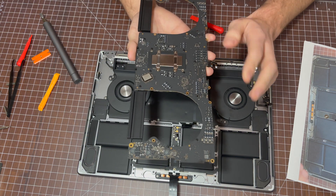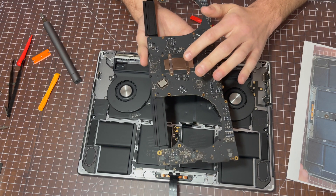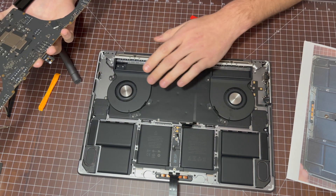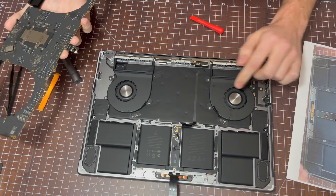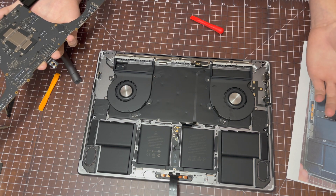Taking a look at the other side, we can see the backplate for the M1 Pro CPU. We're going to have to remove those screws if we want to expose the heat sink. And then looking inside, the fans stay inside — they look pretty low profile to me. We'll go ahead and remove one just for fun.